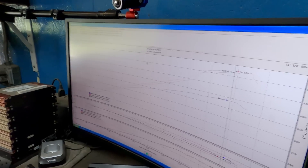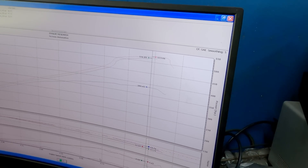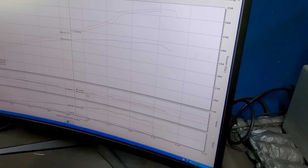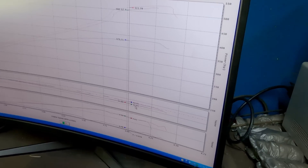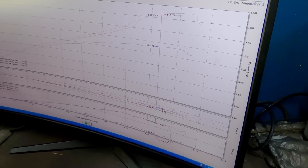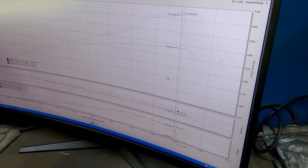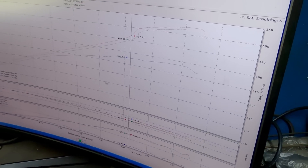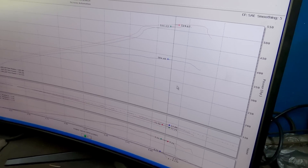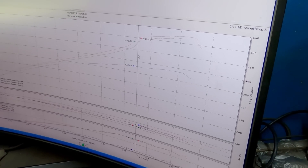526. I stayed in it a little bit longer. Air fuel was 11.8 up top, 11.6 — it's amazing how you can just call it right on the back and get it right the first time. It picked up more through the whole bottom end — we just pulled a little bit of fuel out of it. Is it still pushing through the converter? Yeah. So it's new converter time most likely. Yeah, it needs to be tighter.